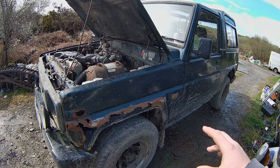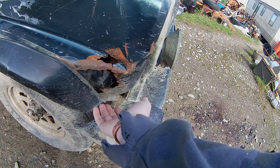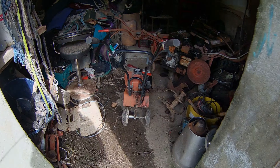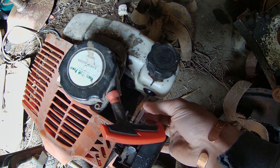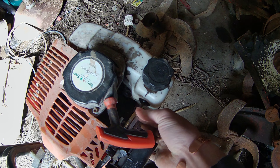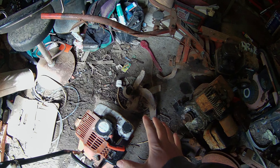This is not being used at the moment because I'm going to do all the brakes. It's not just the front ones - the lines. The brakes and shoes are fine. Metal for the backs is on the way. I think I'm just going to patch this like I can. By the way, I couldn't find the correct fuel lines for this - there's a water pipe leaking somewhere over there. But I found some windscreen washer fluid pipes and they've been on for about a week now. I've been running it a few times and they're quite solid, not expanding. Especially that inlet one - that's proper solid. I think that's what they used before. That's good now, ready to go back to the owner.